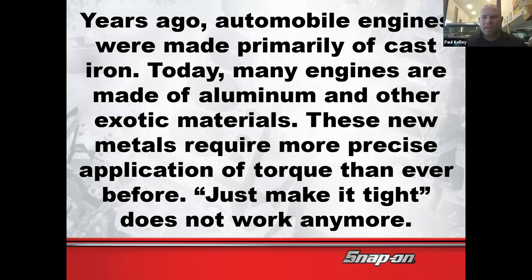So they don't generally put a cotter pin, like through the drain plug or something. They could, by the way, but they generally don't, unless you're running at the racetrack. Sometimes when you run at the racetrack, they'll make you safety wire your drain plug. But generally for automotive, you're allowed to just make sure you torque everything. And sometimes if they're sketched out, they'll put a cotter pin in a steering part because they really don't want you to mess that up.